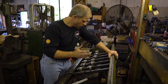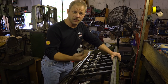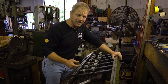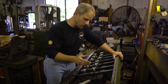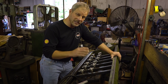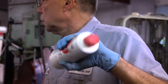Every cylinder has a surface crack on the combustion chamber side - it is not through into the water jacket. Every crack is going to get bigger, it never gets smaller, so at some point we will certainly crack into the water jacket. But for what this motor is going to see, as far as miles and time, we might see 10,000 miles on it, that'll be about it. What we're going to do is put new seats in it, put fresh valves in there, get it all cleaned up really well degreased in that water jacket section, and then put some ceramic sealer into the water jacket - it needs about a week to cure.